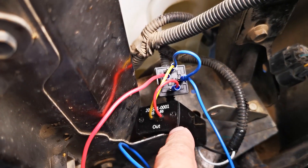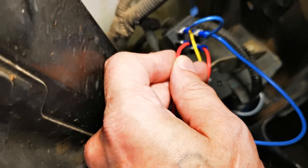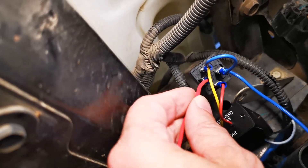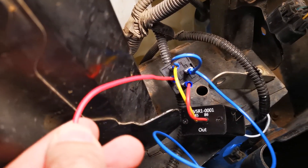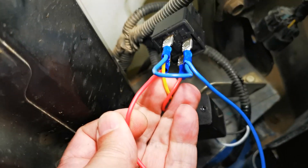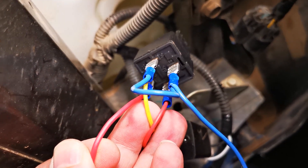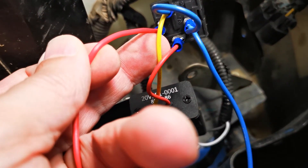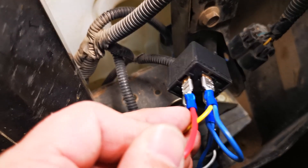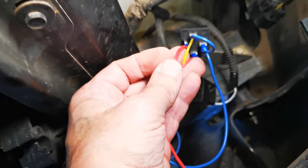As you can see, it's all connected to the relay now. I've pulled a red wire off pin 87 — that will go to the positive on our second horn. There's the jumper between pin 30 and pin 85, and pin 86 is connected to the red wire. That's all we need to worry about there.